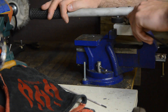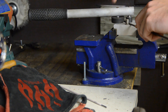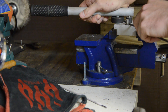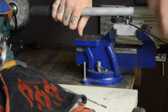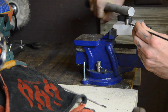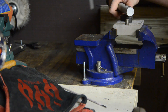All you're doing is putting it in a bind. I've got the small die in the middle because I want a tight curve, and the large die on the outside just to fill the gap. It won't stay down flat because the thing is all crooked, but it puts it in a bind behind this one and we'll bend it around this edge. We'll see — this is solid rod so it's not super easy. Okay, didn't break. Got a pretty good angle out of it.